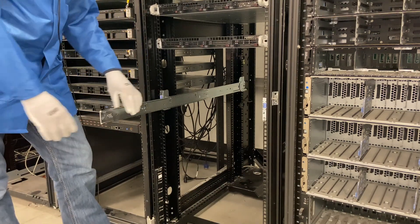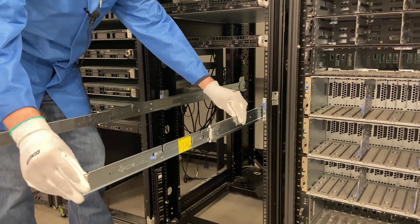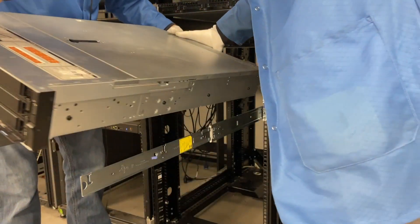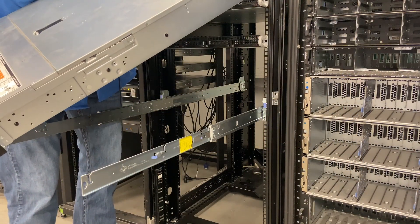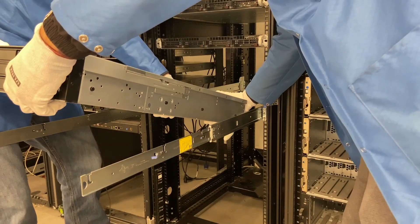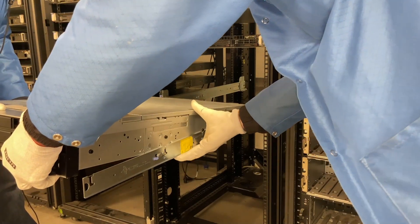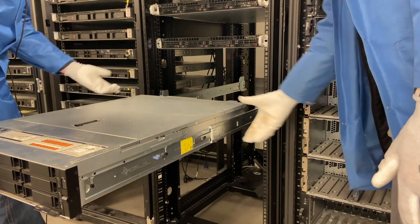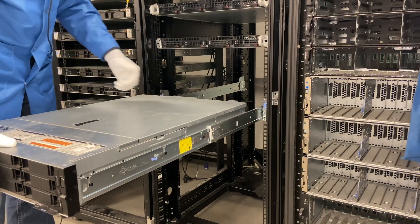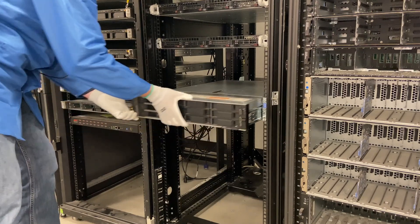So what we're going to want to do now is slide out our inner rail — just pull these all the way out. Again, it's going to click into place and lock. Now we're going to take this one and slide it all the way out — and it's going to click into place and lock. You'll notice on the rails there are notches that are carved out. If you look at the server itself, there are some rivets on the side. Those rivets will let you know exactly how to line this up. What I like to do is take the back ones and put them in first, then simply slide this down and line everything up as we go to make sure they all get in. You can see nobody's holding it — it's firmly into the rack. The rails are even still sticking out. We have to push these buttons on the side; if we try to push this in it is completely locked into place. So we just push these down and it slides right back into place and you can put this into your rack.